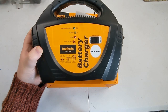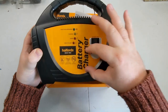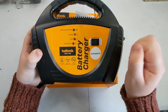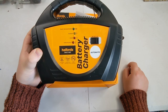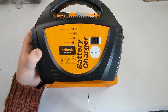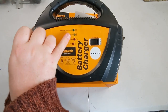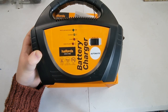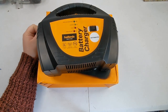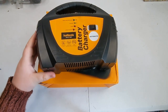Would I recommend it? Yes, with the advisory that it won't charge a completely flat battery. You may want to go for a non-automatic model — just get a cheaper option if you've got a small engine car; you don't need something this big or fancy. Improvements: battery chargers used to have a needle gauge so you knew when it was charged without relying on a light, and it could do with a switch to override the automatic feature for completely flat batteries. Marks out of 10: it's going to be 6.8 out of 10, because of the charge indicator failures and the flat battery issue.